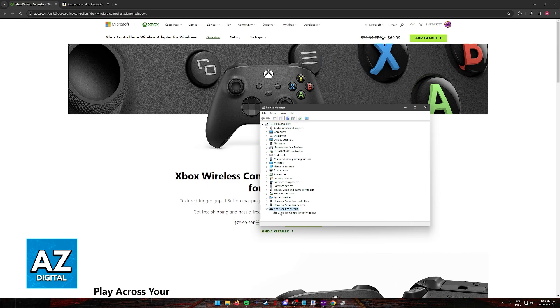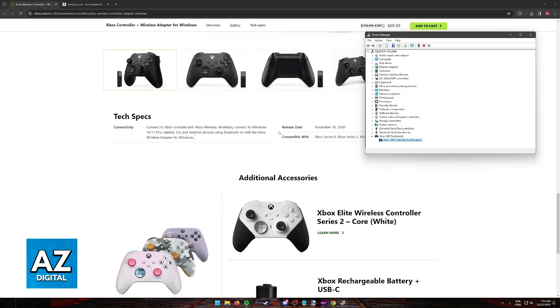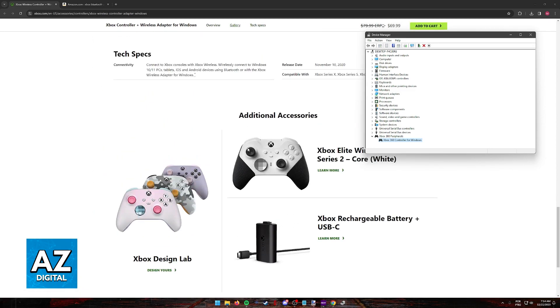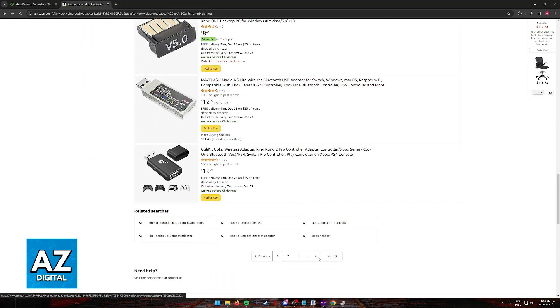As soon as you are done turning on the controller and you make sure that the USB stick or the Xbox Bluetooth adapter is connected, you will be able to find it connected directly to the stick and consequently your controller. So if you go over to the device manager, you will be able to find the Xbox controller that you have. Of course, this could be the classic 360 controller and you are going to need that specific dongle, or alternatively one of the new controllers that they have. Regardless of which option you pick, using any sort of Bluetooth adapter is going to be extremely straightforward.